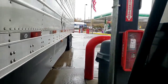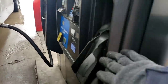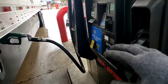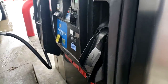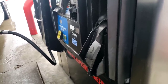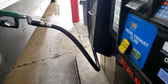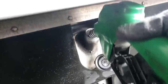Here's something you really have to watch out for. If you are parked too far that way and the hose is coming across this — and sometimes the DEF and this are reversed, which I prefer — the hose interacts with this. Sometimes doing it just barely the wrong way, the hose will knock this thing down and boom, shuts it off and you're done. Whether you're fueling diesel, it's going to think you're finished fueling diesel and it's time to start with your DEF — you've got to cancel the whole thing and start over. Or if you're doing reefer like this, it thinks you're done, and you have to start the process over and get more reefer fuel. Royal pain in the butt. These things always shut off early, so you always have to come out here and really top them off.